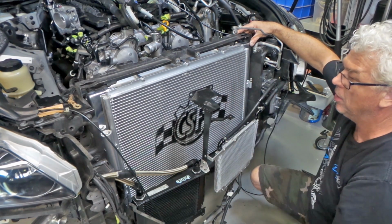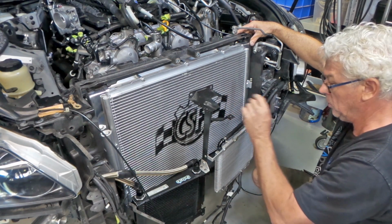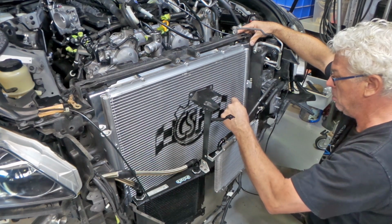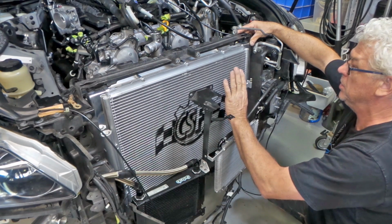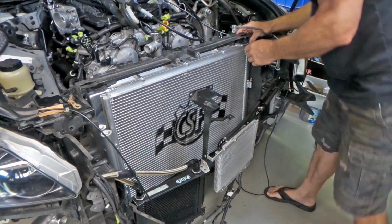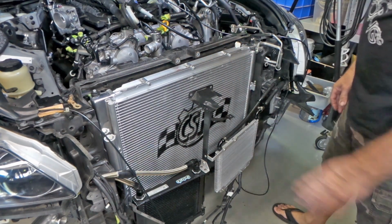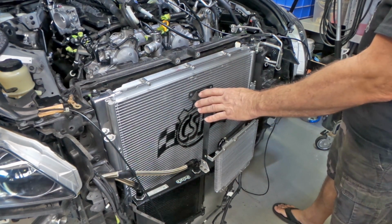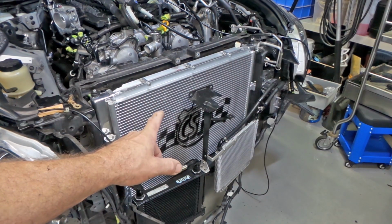But it's like something's kind of twisted. So I'm going to have a bit of a look at this and see what I can come up with. I might have to move the bottom in on this corner a little bit more, which will take the whole side in, because I can't just pull this corner in without twisting the radiator core. Once again, I'll have a little bit of a think about that. I think I might go and have some lunch, have a bit of a think about it, and come back and tackle it. See you after lunch, folks.